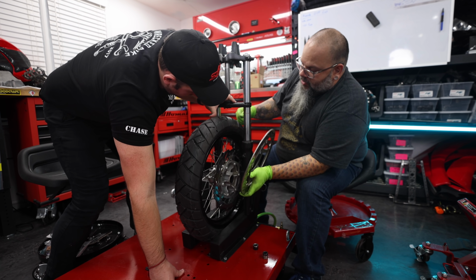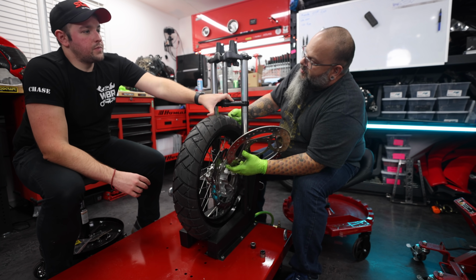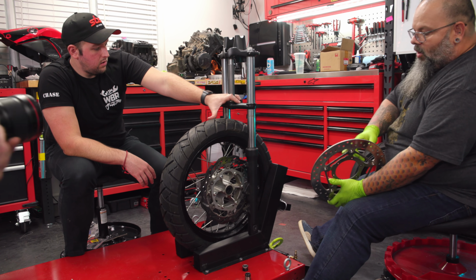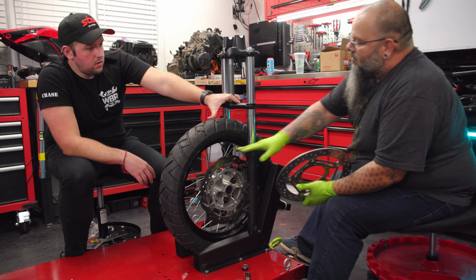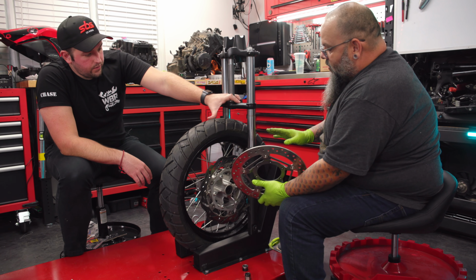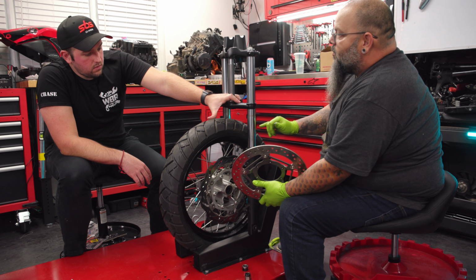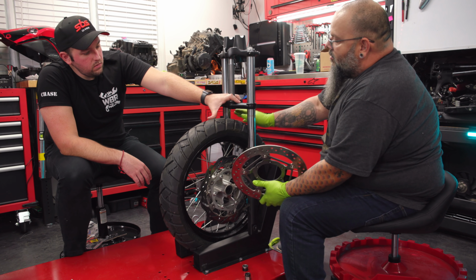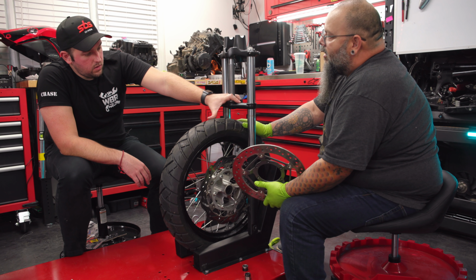And this one's flat. This one is just totally flat. But I do think that the hub for this is wider than the hub for that. Okay. So hopefully this rotor is where it needs to be width-wise. Right. So he'll have to center the wheel first with the spacers, the right bearings and all that stuff. And then from there he can move forward to making the brake line up.